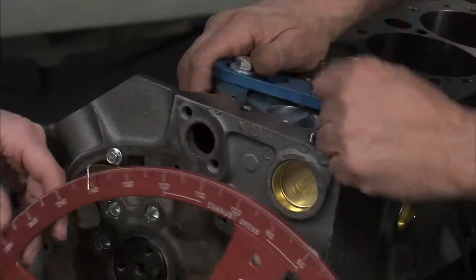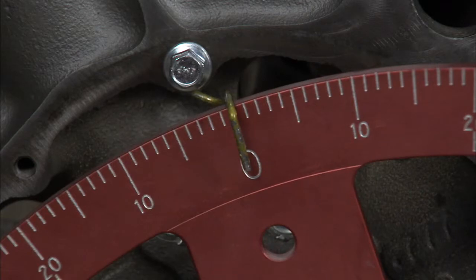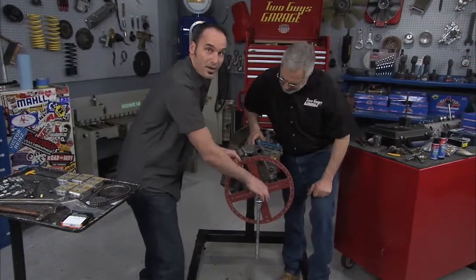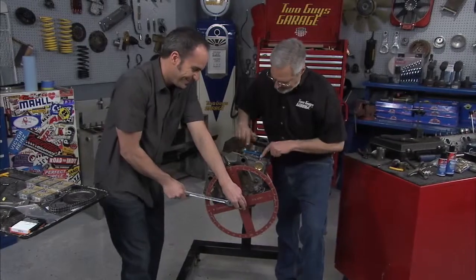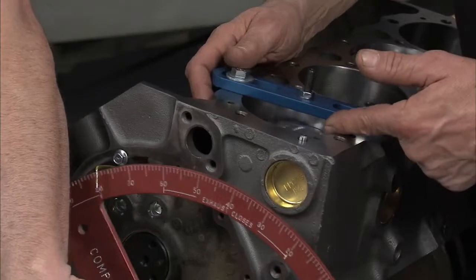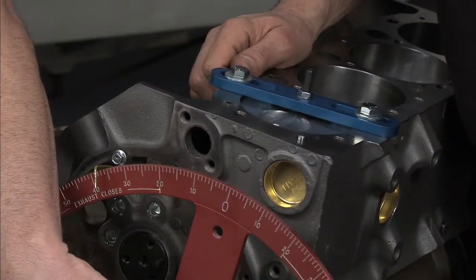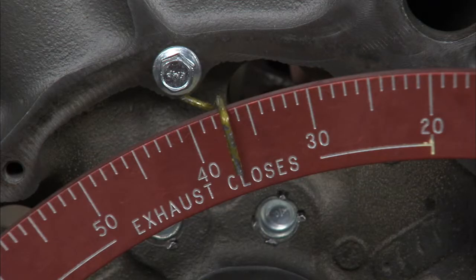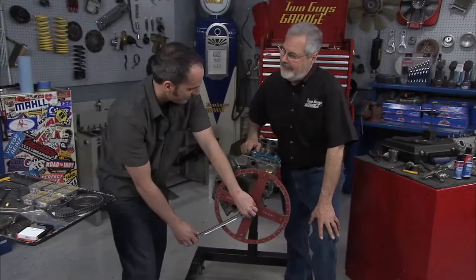What Kevin's going to do is degree the wheel to zero. Put it at zero. This is an arbitrary number because we're actually going to find somewhere between here, but this helps my math — I don't have to add anything but zero and the next number. We get good at avoiding as much math as possible. Anyway, bring the piston back up and change direction. Kevin will feel it. And what are we at? We're at 37 degrees. So we'll divide by two — that's 18 and a half.